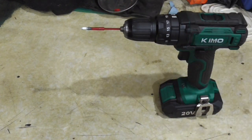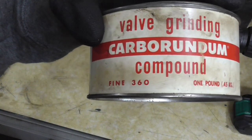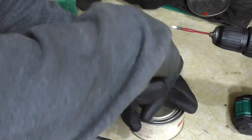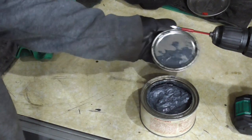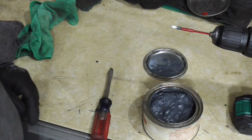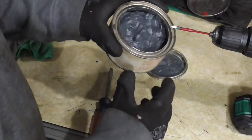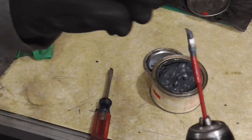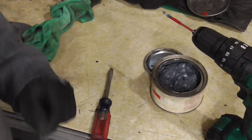I paint it red just so I can find it in my toolbox. What I'll be using for this procedure is this fine 360-grit valve grinding compound — that's a high grit and very fine. Most valve grinding compound is pretty thick and sandy, you can hear it when lapping valves. This one almost looks like peanut butter. We'll take a little bit of this — that's probably more than enough.